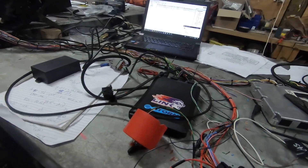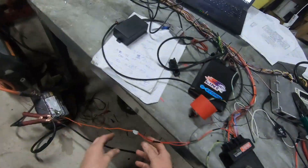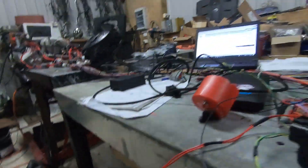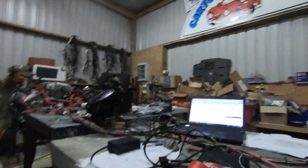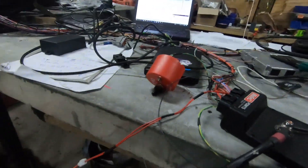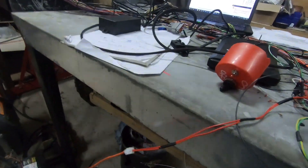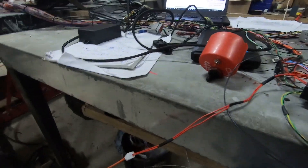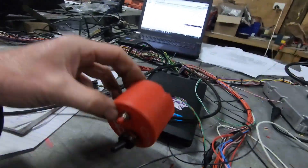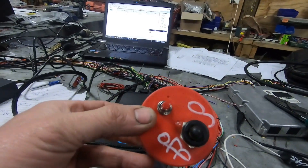I didn't start it, did I? I always start these motors. This wire here — it's got 'fuel pump' written on it, connected to the fuel pump as a temp so you can get it running. That can actually come out anywhere in the loom that you want, but I've just put it there. Those terminals just pull out — run your wires to the loom where you want it, then into those ones. And this is your ignition switch for the moment — on, off, and start.